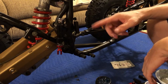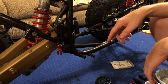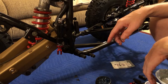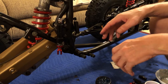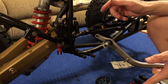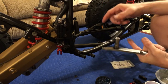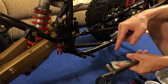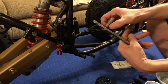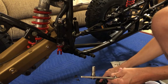I got the seal on the back, but the seal on the front will not fit - I cannot get it in there without damaging it. So I'm going to improvise. What I've done is put the seal on the shaft itself, grease it up, and send it through. It will have no choice but to pull itself into the hole when we tighten it up. It'll work just fine. I'm going to assume it's going to work because it is, so let's grease this guy up.